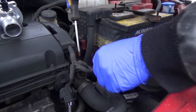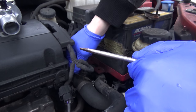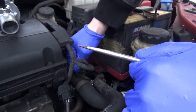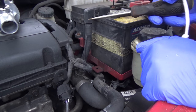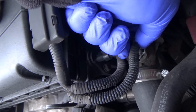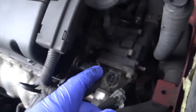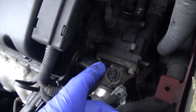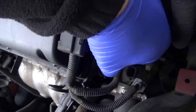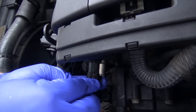I'll go ahead and start by pulling off those two. Did you just use a screwdriver to do that? I sure did, yes. For this one, you have to push in right here, push down a little, push in. I heard it click, and then it should just pop off. For this one, the screwdriver was actually correct. Gently, make sure it's out as far as it can go. This little clip, pushing down on this, feels like it released.